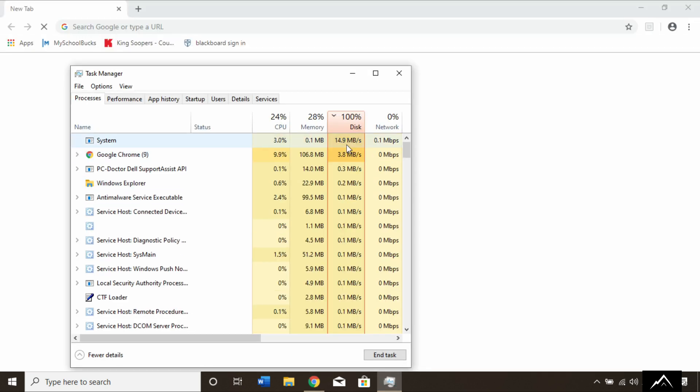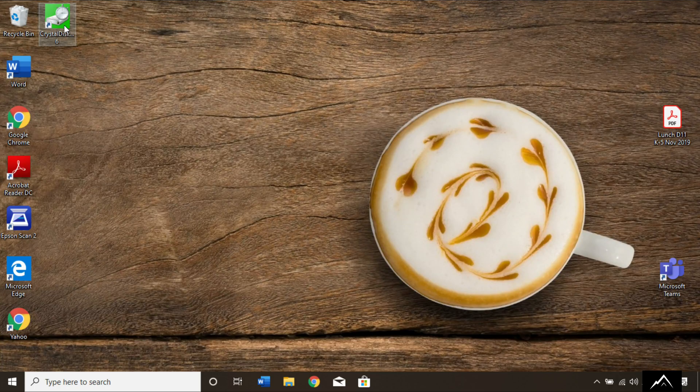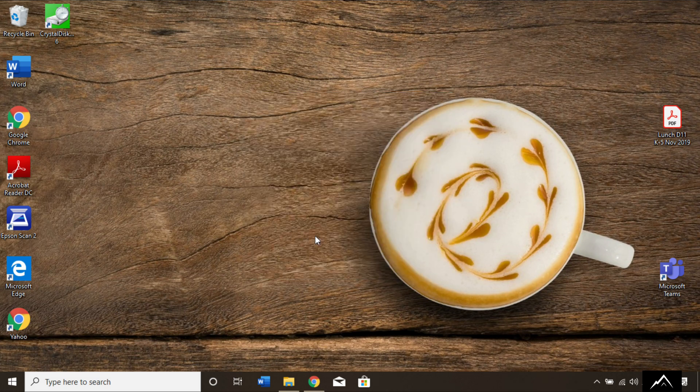The system is fully booted and our drive seems okay now, but let's do something as simple as launch Chrome. We're bottlenecked. Right there is enough to prove that our drive is the reason this laptop runs slower than an asthmatic snail. But let's collect some benchmark data so we have some numerical data to compare after we get a new SSD installed. I'm going to use CrystalDisk to measure the disk read and write speeds — just one run for time's sake. Some fast forward action and the results: you can see our sequential read and write speeds are bad, but better than what we saw in Task Manager. And that's because real world applications access your drive more randomly, and those numbers just suck. So let's get some software to clone this drive.